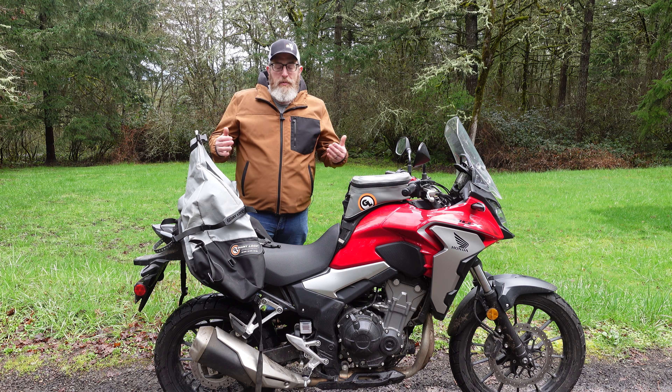If you're going to be running a rogue bag with it, sometimes it's nice to leave yourself just a little bit of a lip on the back side to set that on. But it's not required because the beaver tail straps on the Coyote will hold basically anything you strap to it, as long as it's securely fastened to your motorcycle. Inside the bag and coming through the bottom there's a pronghorn strap. When you get your Coyote this will come with fender hooks on it. If you're attaching it to a dirt bike or something without a subframe where you don't want to go underneath the fender, those fender hooks work great. I've used them on my DRZ, my 450L, and a bunch of other bikes. But with this bike we're going to go underneath the tail, which means we don't need the fender hooks, so I've removed them.